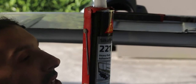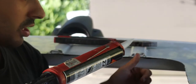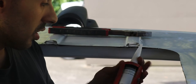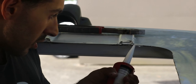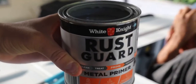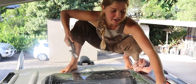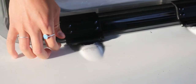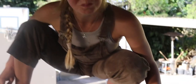Sikaflex 221 — the best, I think they say it's the best for these conversions. So what we're doing is sandwiching. Mickey had a great idea to sandwich Sikaflex in there as an extra layer. So I'm going to get some Sikaflex out now and just put it all through and in. Now for the trusty rust guard. After using the multi-grips to flatten the corrugations, we've inserted the skylight and it fits mostly — we might need to flatten this side out a little bit, but yeah, it's pretty good. It works.